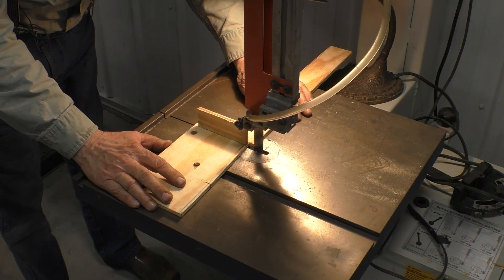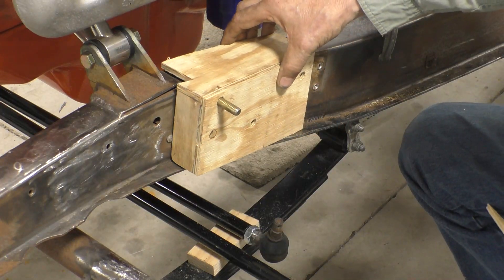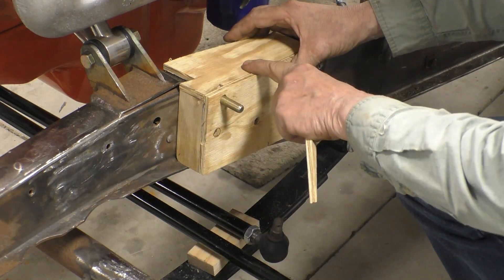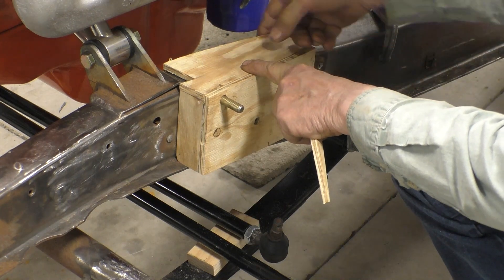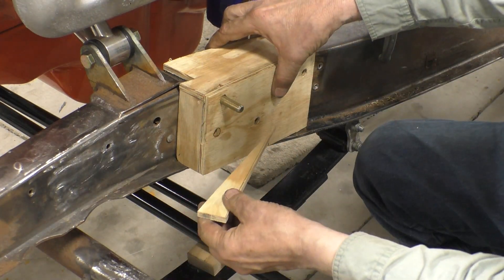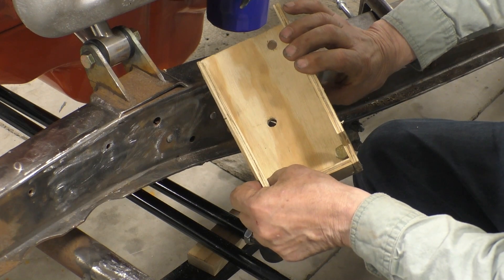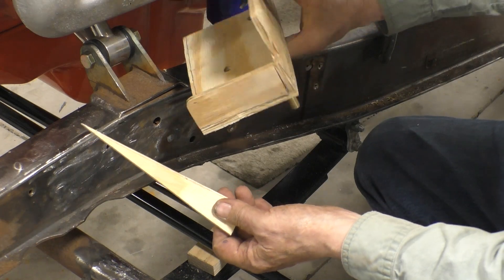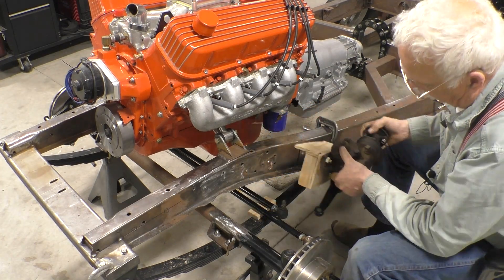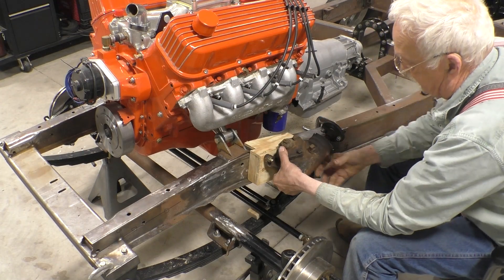We're cutting our jig up. With the top glued on, we can set the bracket in place. The only surface not covered now is the bottom — we've got the front, the top, and the back. We're going to weld this to the frame right around there. I have the bottom cut out and it goes in there just like that — we'll go glue that in and this bracket will be done. Now we can take all the pieces apart and cut out the metal. We have the mock-up all glued together. It fits nicely on the frame. This is what it looks like with the steering box bolted to our mock-up — I think that's going to be just perfect.